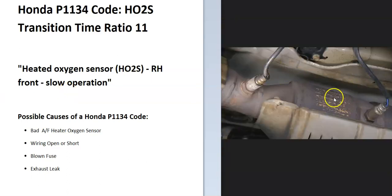There are sensors located on the exhaust and they do two things. First, they monitor how much oxygen was burnt off during combustion, and then the onboard computer uses this information to adjust the air-fuel ratio mixture going into the engine. They also have heater elements built in that help the sensor go into what's called closed loop quicker.